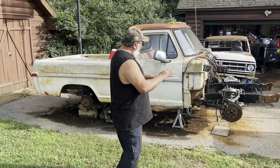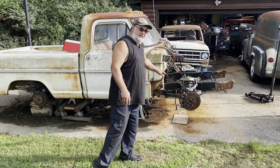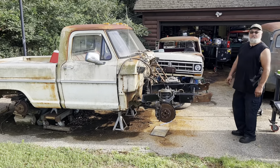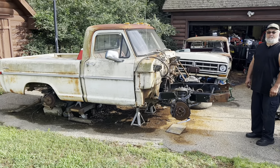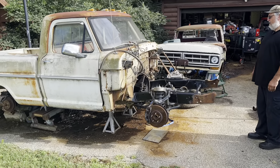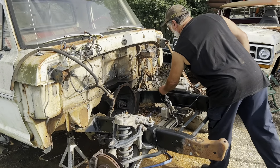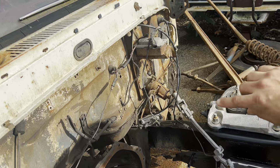You've already got the Crown Vic sub front end pretty much done other than the corners — I like to box them all in. I use the regular pieces from the Crown Vic and I just make them fit. A lot of guys end up doing these subs and they put a box and weld everything in. Gerald doesn't do all that — Gerald goes to the junkyard, cuts everything off, tries to get the whole front half of the frame. Then he comes back to the shop and cuts it into sections to actually box the frame. You take that flange off the bottom of the column and you just adapt it, weld it on and make it fit.